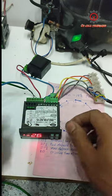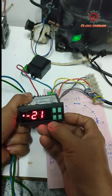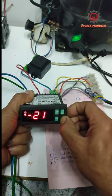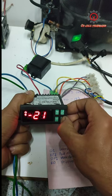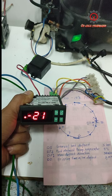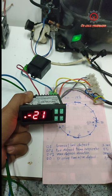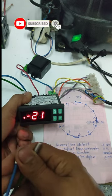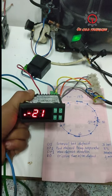I'll remove my two-sensor from my fridge now to deploy the manual defrost. I'm going to hold the sensor so it reads my body temperature, then we're going to activate the manual defrost by pressing this button here. Take a look — defrost is happening now. What I set for DP1 is 30 minutes, but the DP1 will not run the full 30 minutes because I'm holding the sensor.